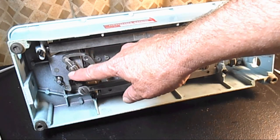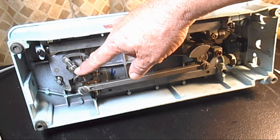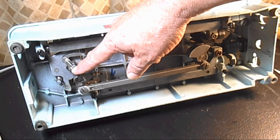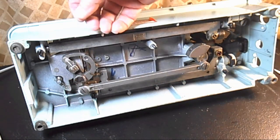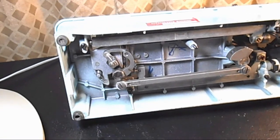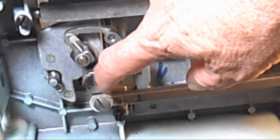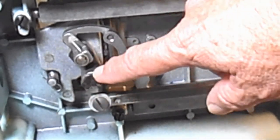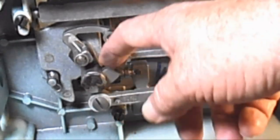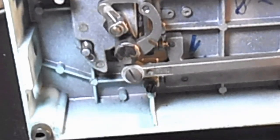But I want to disengage all this from the machine, and the bottom of the oscillating hook post is right here. Once that's all disengaged, I can pull the hook up and inspect these parts. You can still see, I'm thinking you can, that there's some black gunky corrosion on this hinge screw, or hinge bolt. So I'm worried about what that's from and what's inside all these moving parts. Hopefully nothing, somebody just used some weird lubricant.